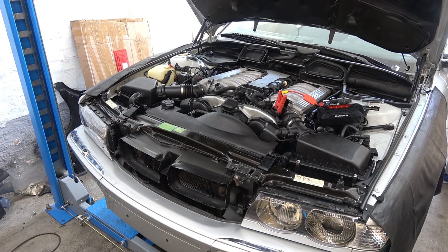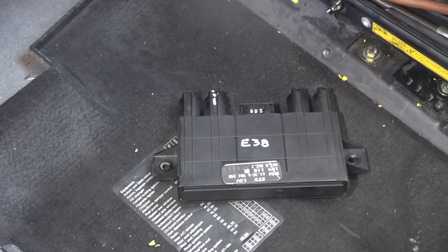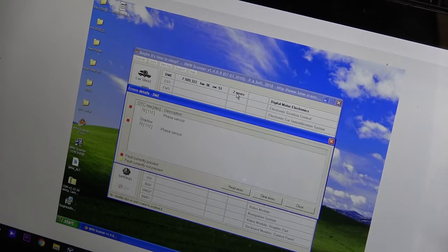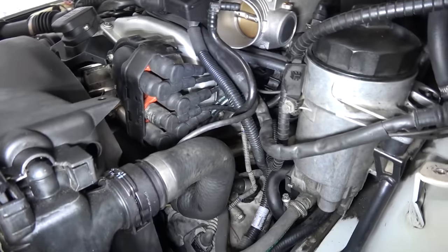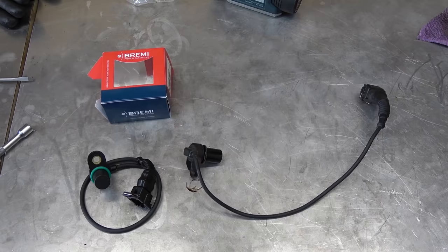After rechecking that I connected everything three times, fuses, relays, I swapped out the battery isolation switch and the stupid thing was starting normally. To reward me for all the hard work that I put into it, it gave me a check engine light and code for camshaft position sensor. Typical, you fix one thing and three more breaks. On the bright side, it's a cheap part that's easily accessible. It is right there in that mess. You can see the screw for it.